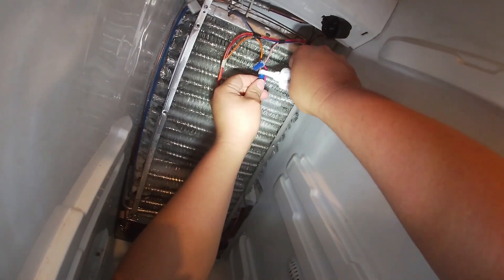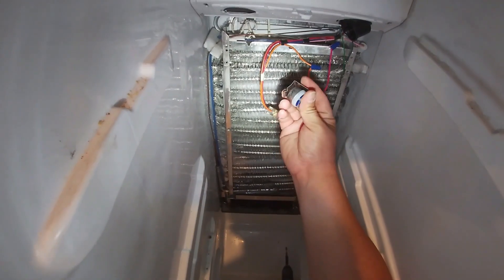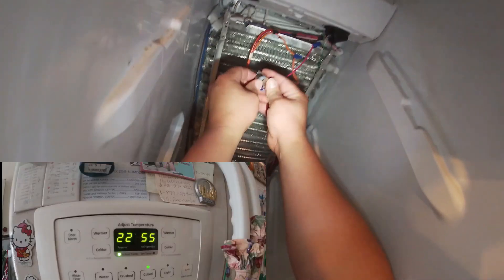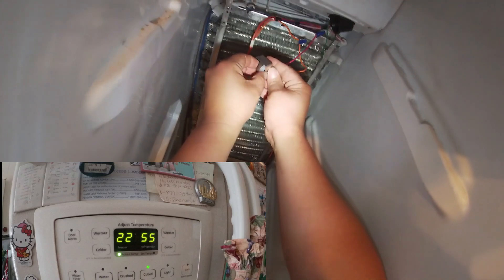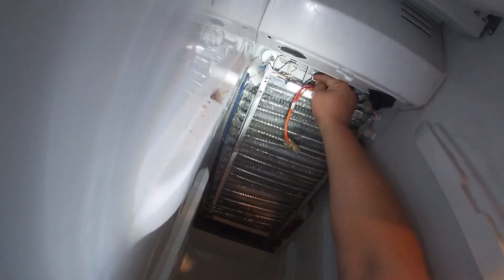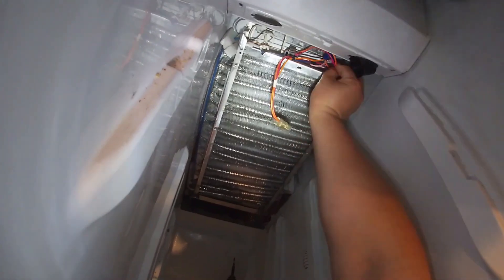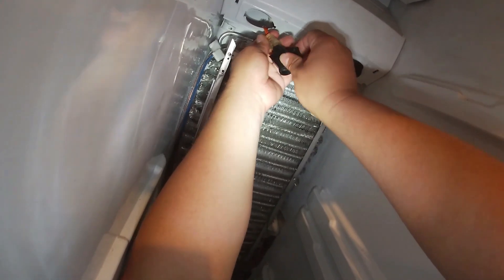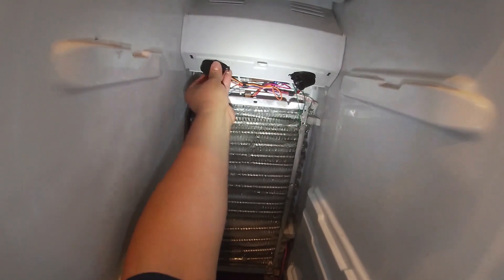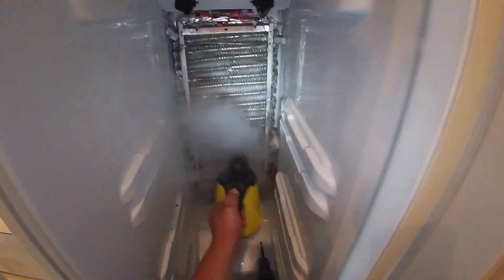Again, I'll keep saying it: none of this was our actual issue. When you have those numbers off on the display, most likely it's going to be the freezer thermistor — not the evaporator thermistor, the freezer thermistor. Go ahead and put your defrost thermostat in place and adjust your wiring. Connect the light bulb attachment and put it in place. Also, if those numbers are kind of crazy, it could be a thermistor on the refrigerator side, but that'll be another video.